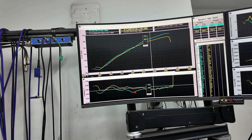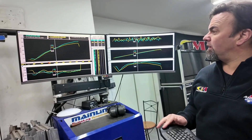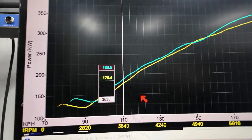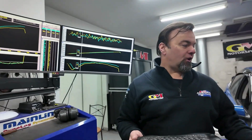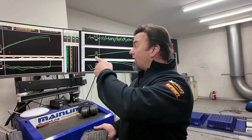Interesting enough, a little bit rich here on the one with the CNC head. But what we're going to show you is that people reckon CNC heads don't do anything — look at it all the way. That's 10 rear wheel kilowatts, that's 20 horsepower. That's just a huge gain. We don't do many without the heads, so when we've done this it's actually a refreshing thing to look at and go, wow, how good are our heads.